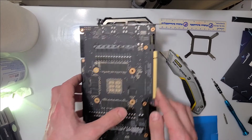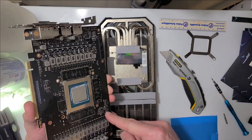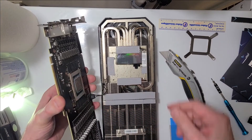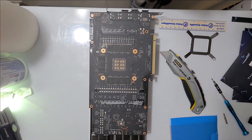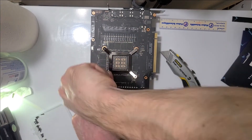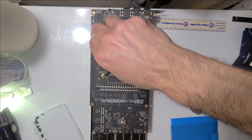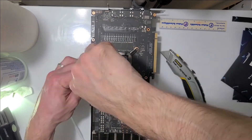So this is going on here. Got the four screws there — I have to redo these pins. One goes here, one goes here. Now we're going to screw it in a star pattern so there's nice even pressure. Those are all down.